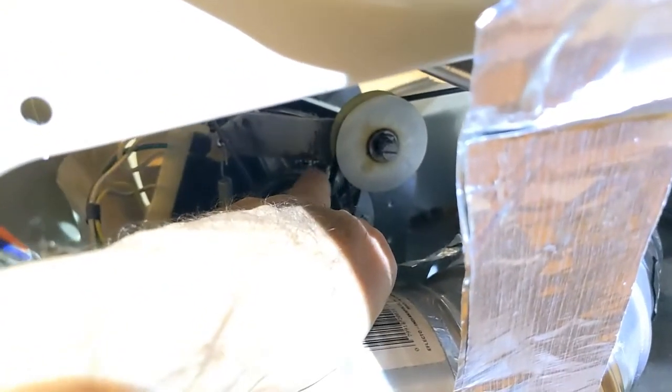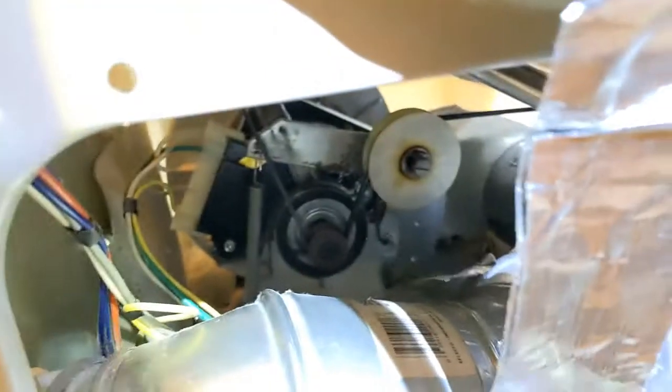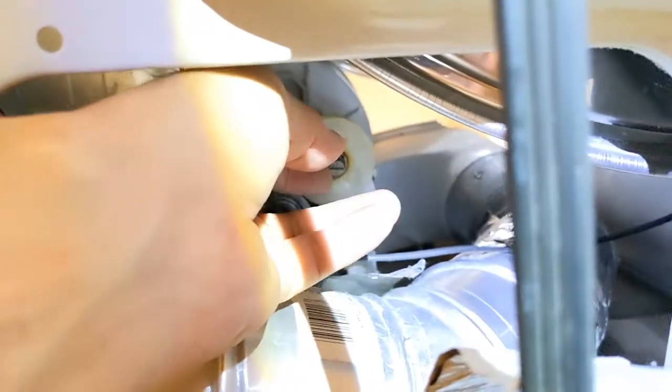And you're going to reach in, and there is a tensioner pulley right there. And you're going to push on that to release the belt. Now, this whole pulley mechanism, it's not screwed in tight. It just sits there. So be careful it doesn't fall out of place. I'm going to need two hands to take the tension off this. Okay, now that the belt is off,